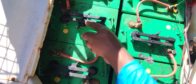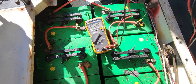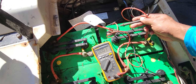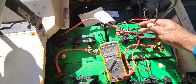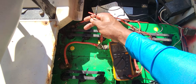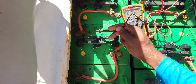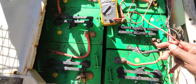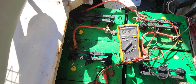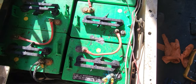This is a six-volt battery — each one of these batteries is six volts to make a combined 36 volts. After you've checked the terminals, you want to check the voltage of the battery. Nominal voltage on this battery is 5.9 — that's within the acceptable range because these are six-volt batteries and that's really close to six volts. If it gets down to four volts, that's where you know you have a problem. Four volts indicates a probably bad cell or a seriously discharged battery. We're checking each one — they're really close to six volts, which basically means they need charging but probably are not bad, though they are very much at the end of their life.